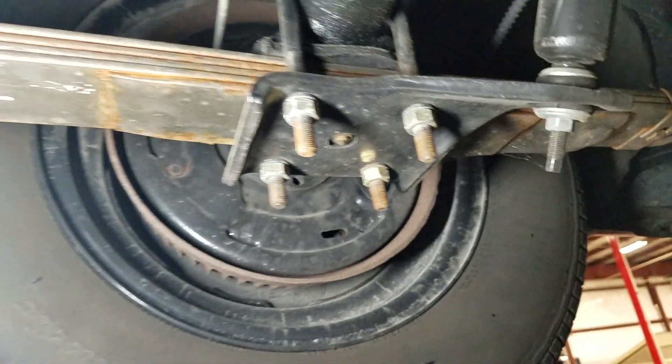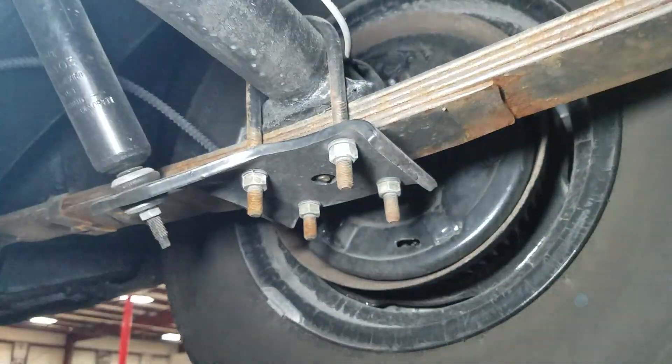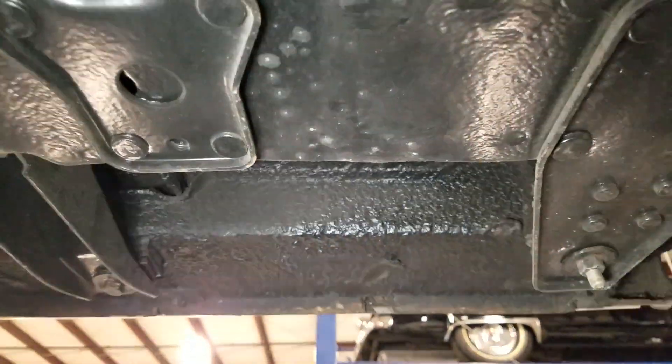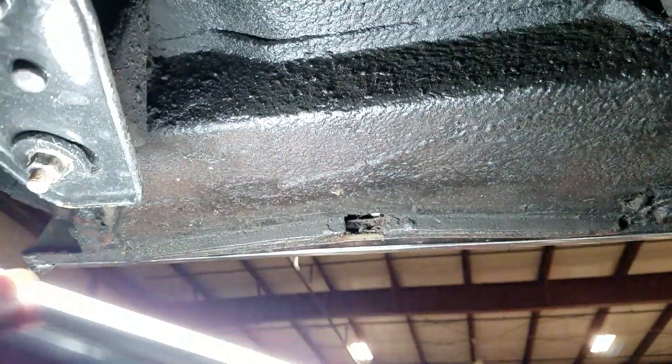Center floor structure looks real nice. Fuel lines, brake lines, clips. Proportioning valve up there. Pinions and snubbers were changed. I think everything was serviced on this vehicle. Dana rear end. Right here on the opposite side a hoist pad came in at some point in time and we have a little bit — see how that one's more straight and this one has a little bit of a dip to it. Nothing too bad but you can kind of see what I'm talking about — a little bit of lifting.